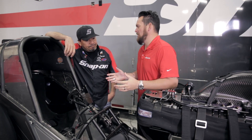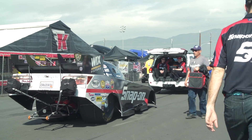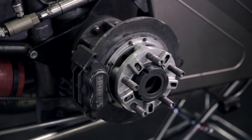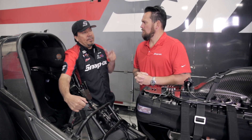What are the components? These aren't factory brakes. For starters, we have a parachute. Without the parachute on some of these racetracks, this car would not stop in time. Parachutes are the first thing I hit when I'm going through the finish line. The second thing I do, I reach over and grab the brake and pull back on it — it's a four-wheel carbon fiber disc brake system. This car is about 2,600 pounds, so it stops fairly quick, but it has to have the parachutes.